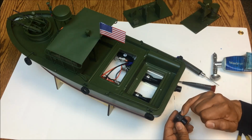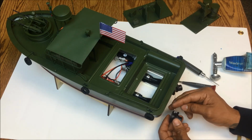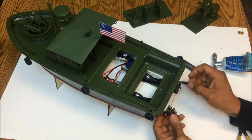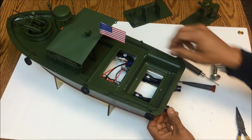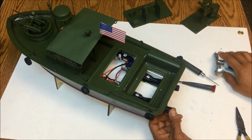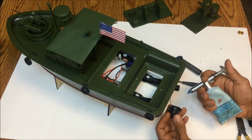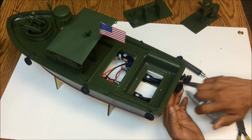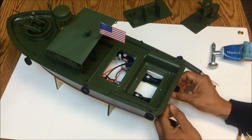You want to go ahead and use the T-shape on the arm there to put it back. And then we want to go ahead and pull our servo back forward again. If you'd like at this point, because we put our thumbs on the end, you could add a dab of grease into each one of these bushings to prevent any premature wear or excessive wear.